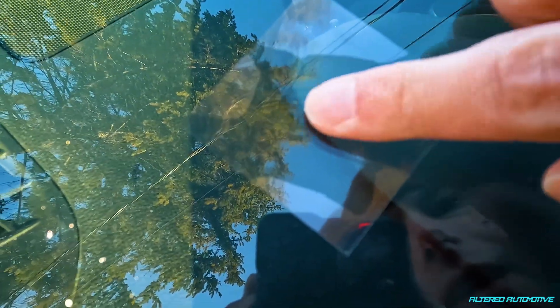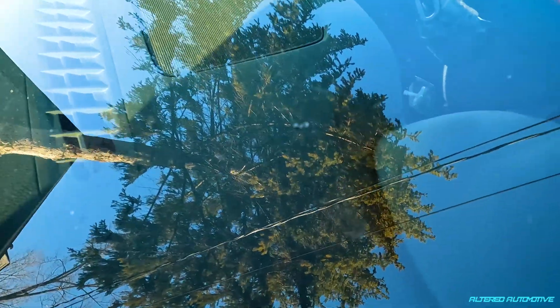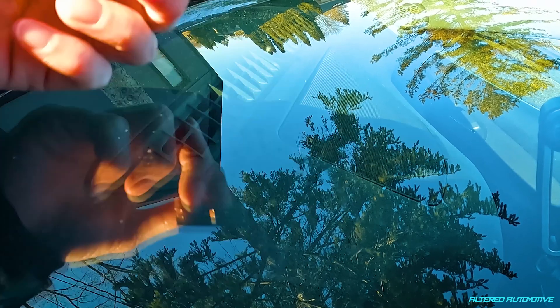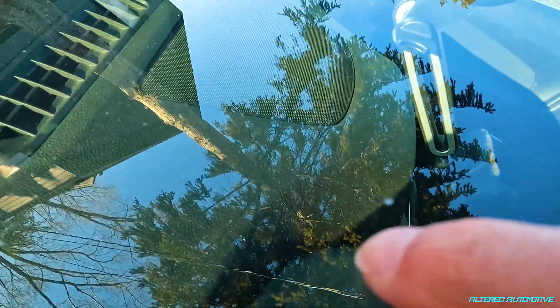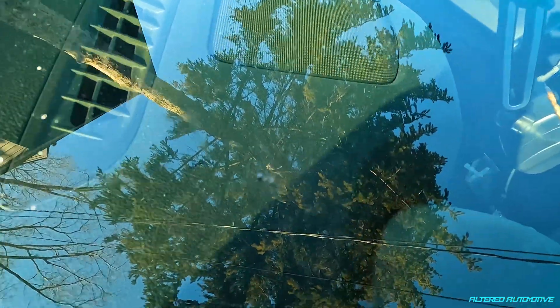One eternity later. Here it is — it's been about an hour. It doesn't look too bad. The camera doesn't pick it up as well as I can see it, but it definitely looks like it's filled in a little bit. So I guess we just peel this off. Got some resin left over — we'll grab the razor and scrape that up. This is the final product right here. You can still see the crack from the outside, but compared to the other chips, this one is buttery smooth — you cannot feel that there's a crack there at all.